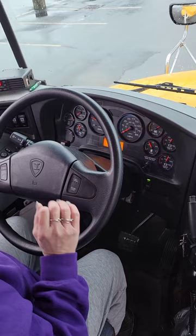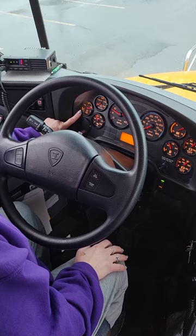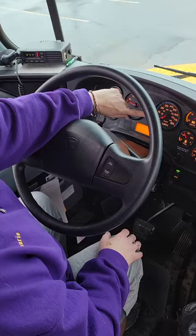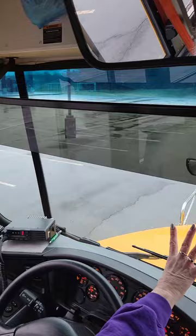I'm going to put on my headlights. My dashboard lights up. I'm above three-quarter tank on the DEF — you've got to tell them what the gauge reads. My water temperature is rising, but not above 220. My oil pressure is between 30 and 50. My speedometer worked on the way here. My volts read between 12 and 14. I have enough fuel for the trip. My air pressure is still building. My windshield is not broken, cracked, and has no stickers or obstructions.